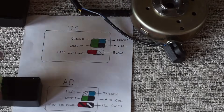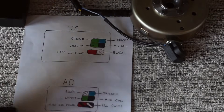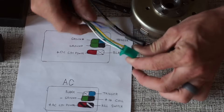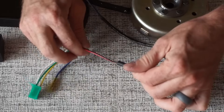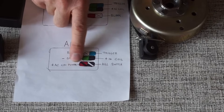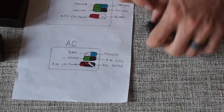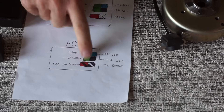Remember we had just 12 volts going to our power source on our DC CDI box. Well, how do we get AC volts to our AC CDI box? You see these wires here? That blue wire is the trigger coil — it goes right here. And then the red wire with the black stripe — sometimes these colors change — supplies power to our AC CDI box. The only way that happens is if the engine is cranking over, creating the AC voltage. And then you just have a kill switch up on your hand control. That's how that works.